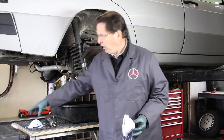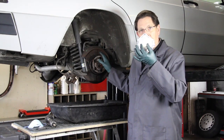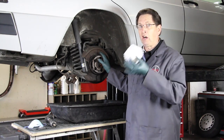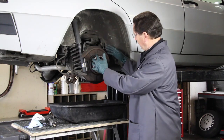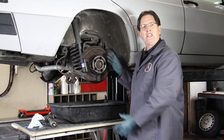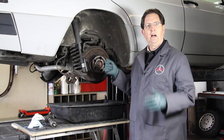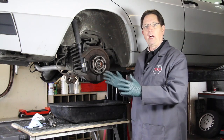I've already wetted this down, so I'm not going to be putting the face mask on now because it would be very difficult for you to hear what I'm saying — but I would have this on if I were doing this. You're going to see a lot of dust and dirt from accumulation of brake dust and road grime in here. The one thing you never want to do is hit it with compressed air, as that's going to put all kinds of dust into the air in your garage or shop.